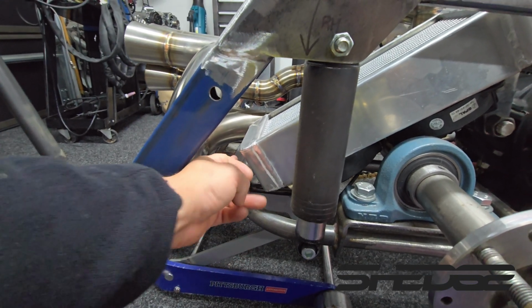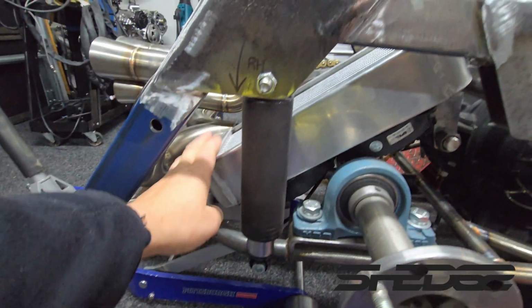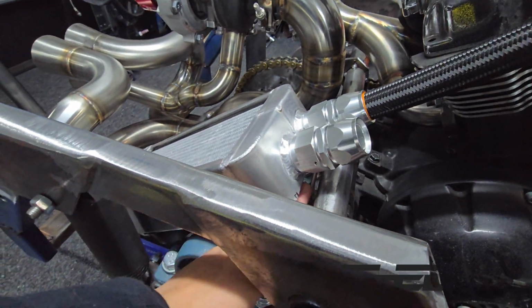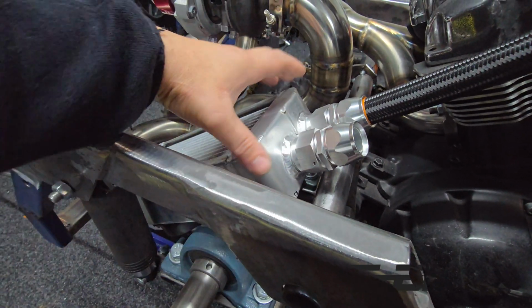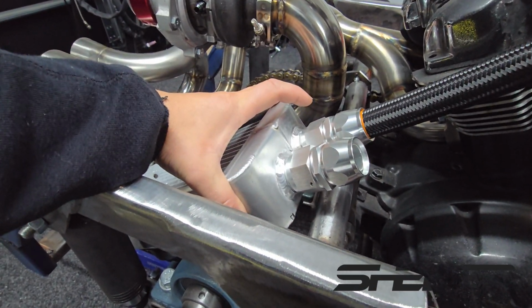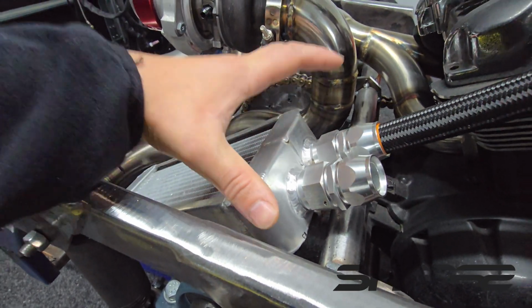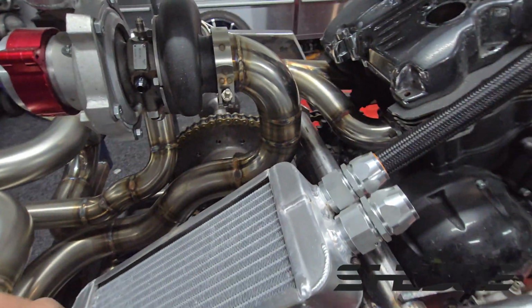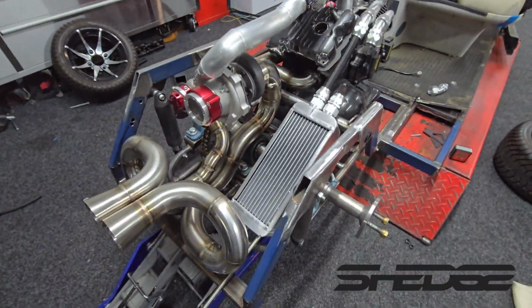We'll bolt it to the lower half of the radiator header, and then as for the top half, we'll have it a pin style somehow so it's still floating between some grommets. So basically only the lower half will be bolted, and this half up here will be floating. You actually won't be able to move it, but there'll still be some wiggle room in there for it to take up a bit of vibration. So I think we're going to run with that.